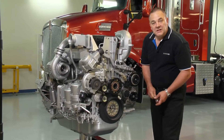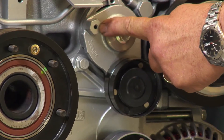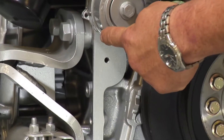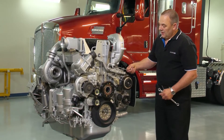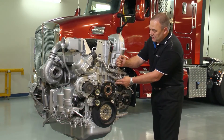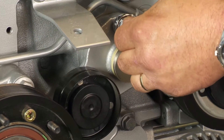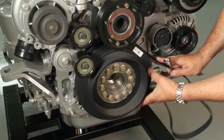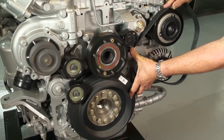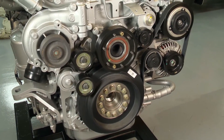To remove and replace these belts, you will notice that there is a locating hole for the PK7 tensioner and also for the PK9 tensioner. The method for replacing these belts is to compress the tensioner and install a locating pin in the locating pin hole. This will keep the tensioner in a compressed state. Once the belt is changed, remove the locating pin and relax the tensioner onto the belt to maintain belt tension.